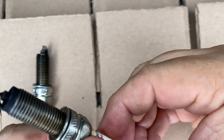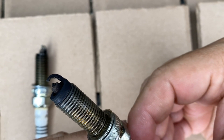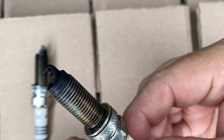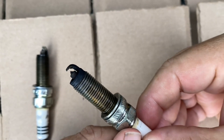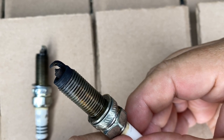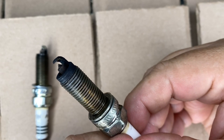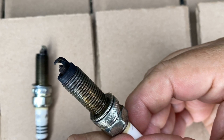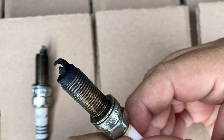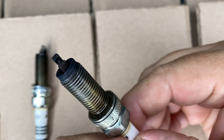The next one — if you see a spark plug like this, that's just the end of it all gunked up and burnt looking. This is caused by liquid oil getting into the cylinder. There are a number of different reasons: if you had bad piston rings where oil is seeping past them, or if you accidentally overfill the car with oil and it's working its way back down into the cylinder — that's what causes that: liquid oil.